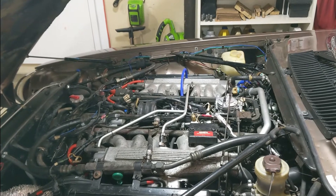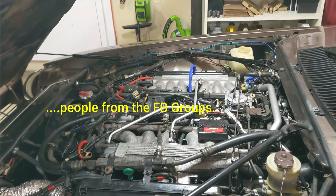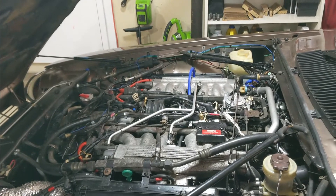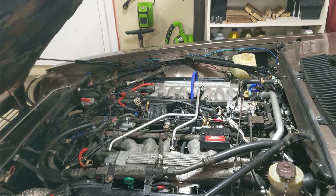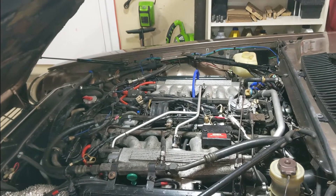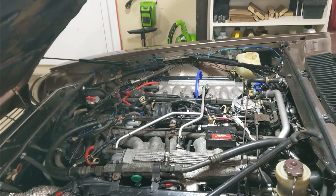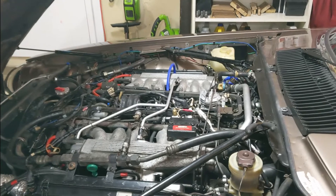The first thing is that people have speculated it's a fuel problem — i.e., not enough fuel going into the cylinders. I've read somewhere that while the ignition is on and the pump is running during priming, if you blip the throttle more than halfway, you fire a little fuel into all of the cylinders, and that does help. But I'm going to check that with a noid light.